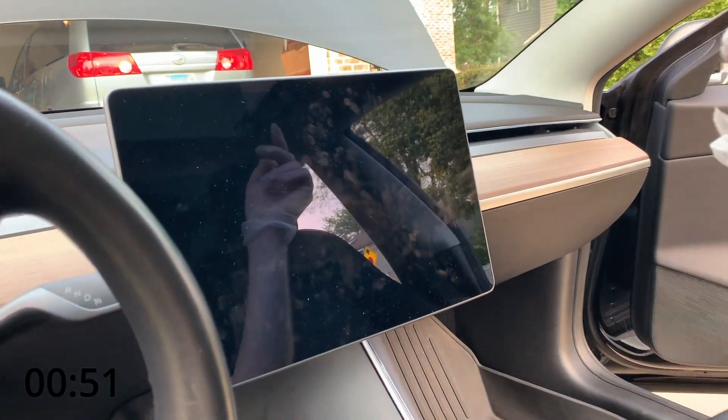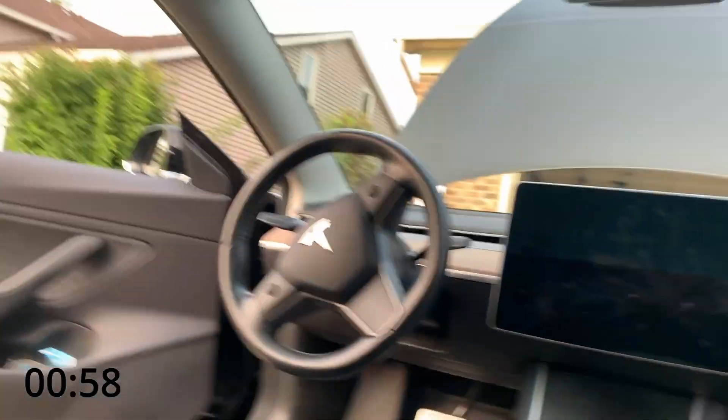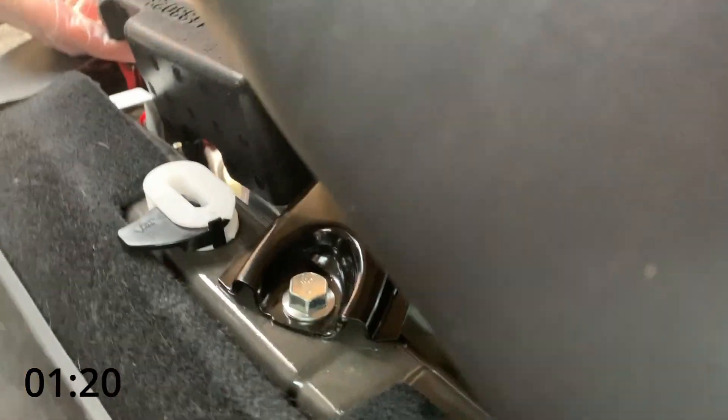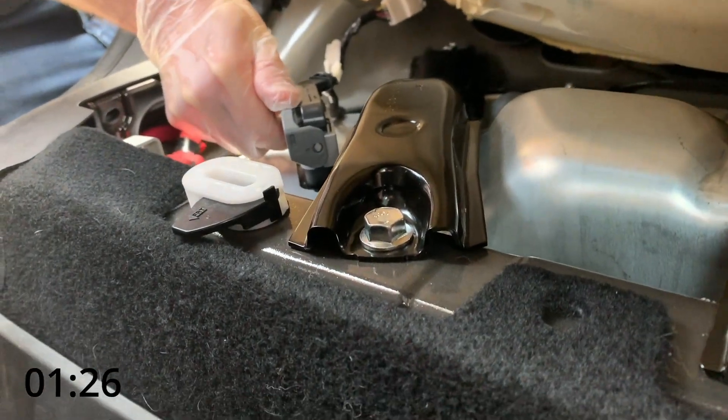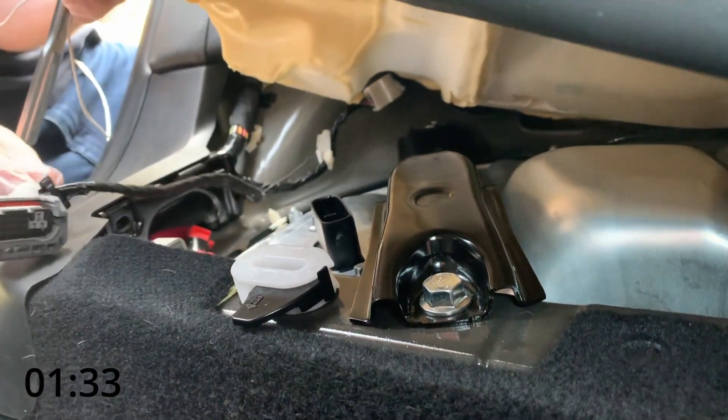Now we go into the seat here. You're gonna see on the back seat there's a little latch — if you put your finger underneath the seat you'll find it, it's a little bit tricky. Find it right in there, then lift up on the seat and it will actually come out a little bit. You'll see there's a little styrofoam block — pull that out — then there's a latch right here, pull this down. Pull this out all the way, take this connector out, then gently let the seat back down, leaving the styrofoam in place.